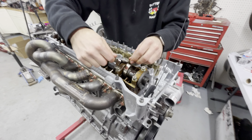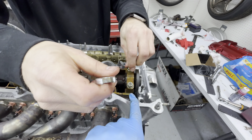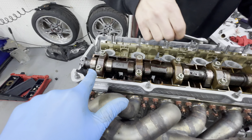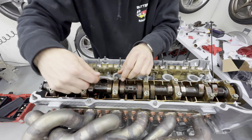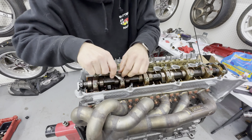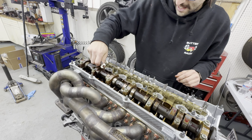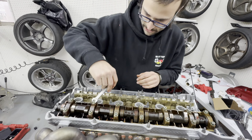This is the exhaust cam in place. Everything's lubed up. Make sure all the cam caps are labeled - A1 all the way through A7. Then we're going to slowly work the cam down. It's kind of a scary process. It's a little sketchy, but you just go slow and see where the points of pressure come in as you tighten things down. Then the rest of them kind of walk down nice and easy. At the end of the day, everything's nice and flat. Nothing breaks and you can breathe a sigh of relief and move on to the next cam.